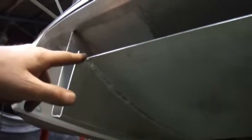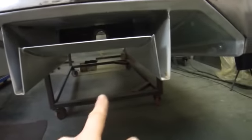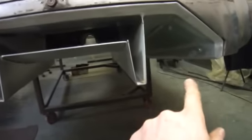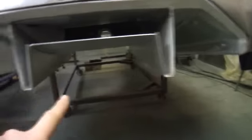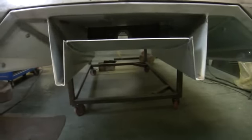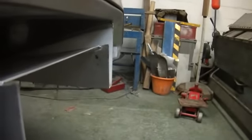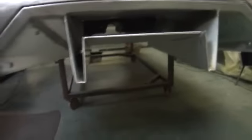If you look carefully — I'll turn the camera angle — you can see that there. Are you wondering why that's different? Well, this area here especially will also be causing a negative pressure area which will create a downward effect. The idea is that there'll be a low pressure zone running at the back of here, as the air is exiting the back of the car — or rather, as the car is cutting through the air.